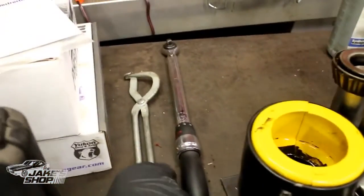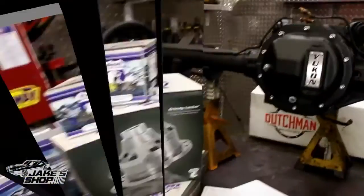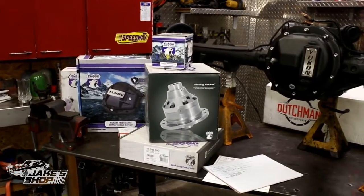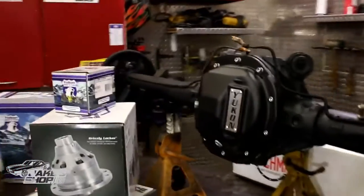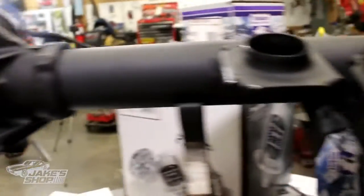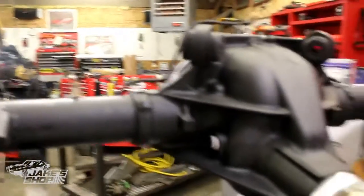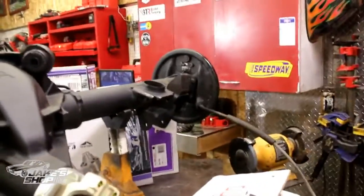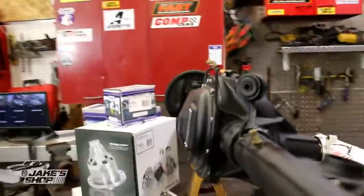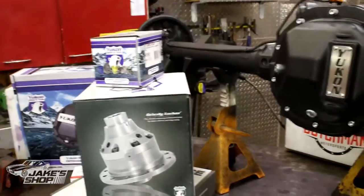I would obviously have a brake tool for the drum brakes as well — I didn't really go into removing the brakes on this axle. Next process is really deciding what parts to buy, and it's an enigma. You definitely want to look at your axles and the car year and manufacturer, sure. But when you're dealing with old muscle cars, you never know — people change these suckers out, they've rebuilt them. Really what you're looking for is the identification on the housing. Sometimes it's in different locations, but most times on that front driver or passenger side. Most of that is going to be making phone calls and talking with the guys you're getting your parts from.